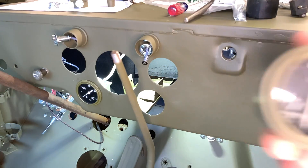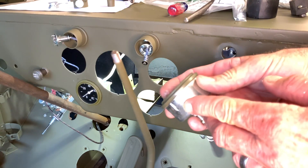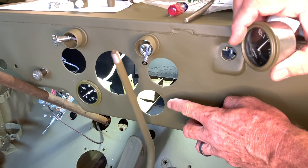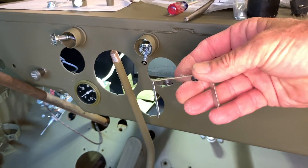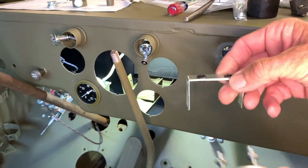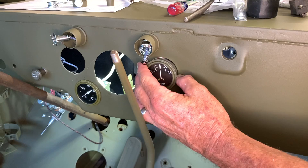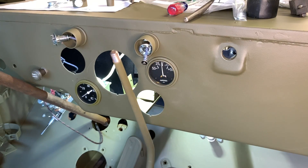Let's go ahead and install it onto the dash. If you flip the ammeter to the underside, you'll see a little dimple or indent, and it fits into the slot cut in the bottom of the top hole on the dashboard on the passenger side. This is the bracket — notice the little sleeves or inserts. We'll remove the top two nuts and install the ammeter into the dash, making sure that dimple gets into that groove.